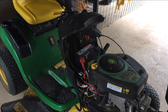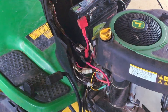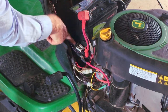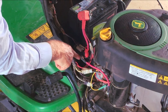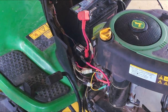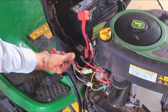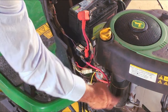Next, what you can do is bypass all of that directly just to see if we can get it to crank. You see down here - this red lead just goes from the positive terminal to the solenoid here, and from there it goes through the switch straight down to the starter motor. So all that happens is when you turn the key it puts power on these two terminals, and that closes the solenoid and engages - sends power through to the crank.